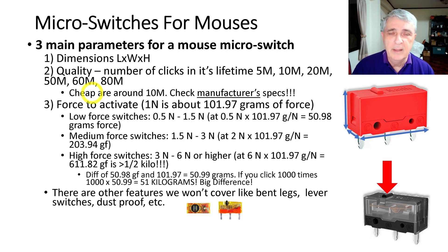The cheap switches — like the ones I replaced in my expensive mouse — are about 10 million clicks, which may seem like a lot but apparently it's not. When you buy these, check the manufacturer's specs, because sellers can be misleading. I've seen a switch rated at 5 million by the manufacturer listed as 10 or 20 million by the seller, so buyer beware.